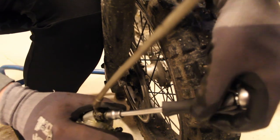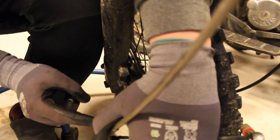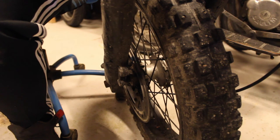As you can see, the brake fluid is starting to leak, which is normal and is to be expected. Now once you've got the brake caliper out, the banjo screw will leak quite a lot of brake fluid. But there is a way to avoid major spillage, and that is not to open the master cylinder when this is happening. If you have the master cylinder closed, it will give negative pressure and keep a lot of oil inside.